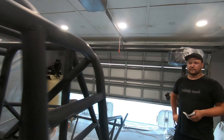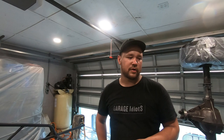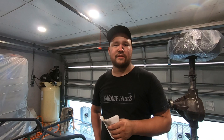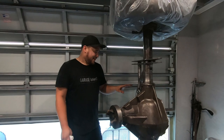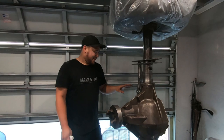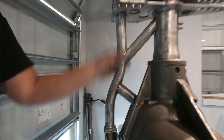Kind of different this time - didn't bother taping off all the walls, tried to get better ventilation so it just pulls all the air out. All the bare spots, I'm going to lay some epoxy primer on first, and then we're going to hit it with some Eastwood single-stage black - their Rat Rod satin black. Nice thing about single-stage, you don't have to clear it. It's pretty cheap paint and it'll look just like before where it's a really low-gloss black. It'll be a lot more impervious to chemicals. Earlier I got the axle on the truck also. You can see the new wishbone mount with some nice gussets to keep everything straight, really hold the four-link brackets in place. Just wiping it down with some lacquer thinner and then we're going to start laying some paint.